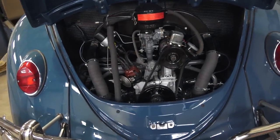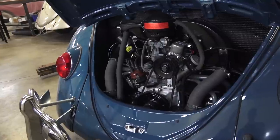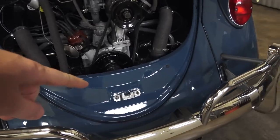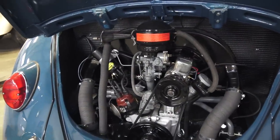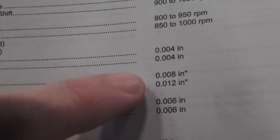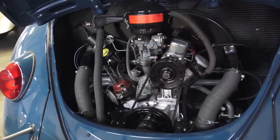Here's your gorgeous 40 horsepower motor — and this is the last year of the 40 horse motor. In '65 the heads were different and the studs changed as well; you can look that up in a Haynes or Bentley manual. Also the apron changed this year — now you don't have the painted catch on the apron, you have a new metal bracket for the push button latch. The 40 horsepower is a different animal for valve adjustments: it's 8 thousandths on the intake and 12 thousandths on the exhaust, which seems odd because people always say six thousandths, but it's not across the board.